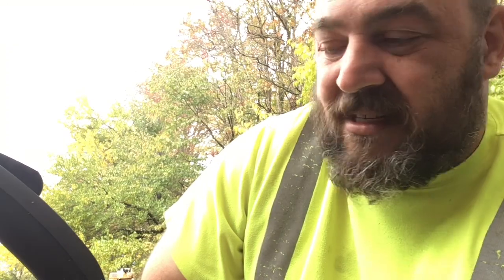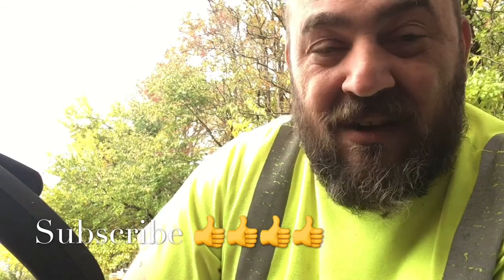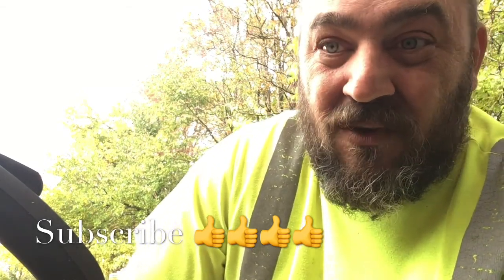It literally ran just a couple of seconds. I ran full choke, full throttle, and just yanked on it, and I never got to the point that it was flooded. Maybe a pop here and there, but that's it. So I definitely think it's lean. I'll probably just have to tweak that metering lever just a hair higher. Whenever I set it the last time, I thought it might have been just a little too low, and it ended up running. But I think it ran because of me flooding it so many times in a row. It had enough fuel in there to get it going. You know what I mean? But then after I got that all burned off, it went. Even the last time you saw it running, it went lean and shut off on me.